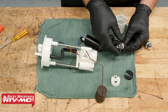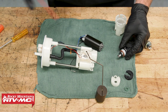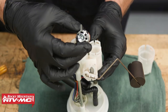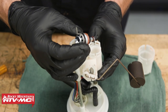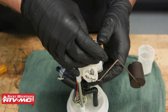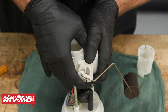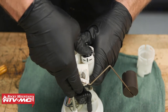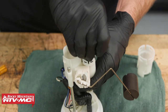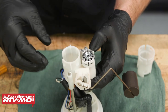To put this thing in easier, I'm going to use a little bit of silicone spray on the rubber parts. Now that we have this body cleaned out, we want to make sure the pressure regulator is in the correct orientation — this tab is facing this corner — and then press it into place. Check and make sure all four tabs are locked in and that the ring on top is still tight and this piece isn't going anywhere.